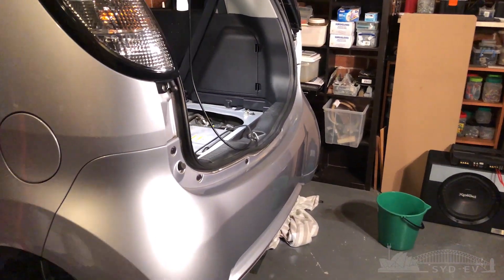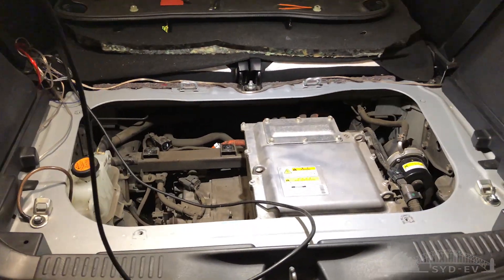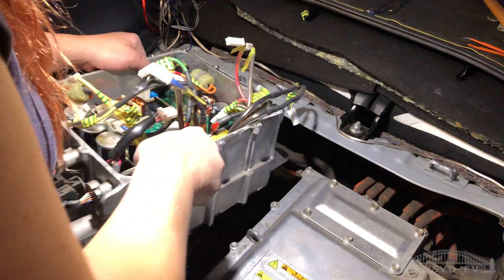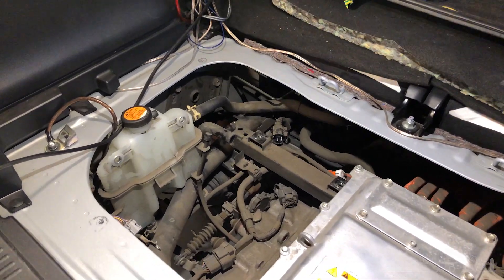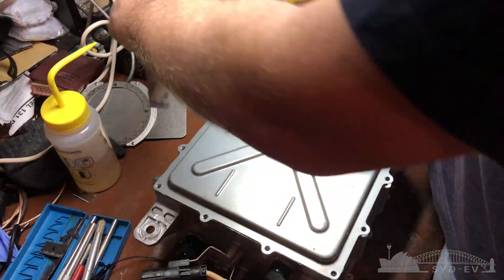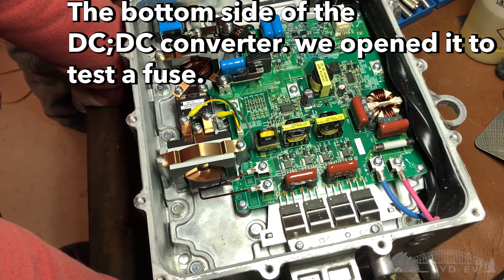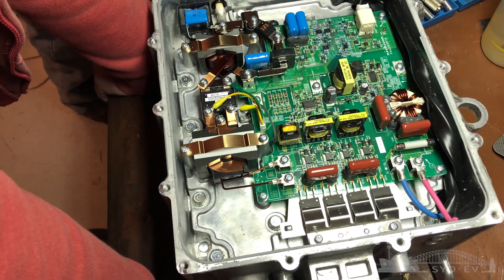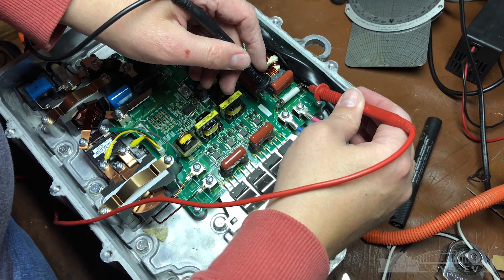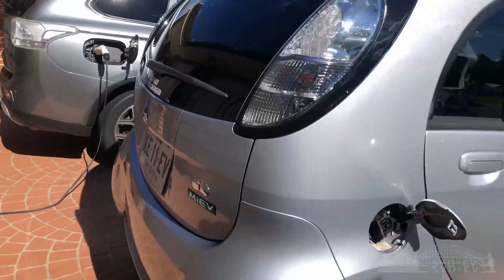That's pretty much the end of part one. The next video covers the actual repair of the converter itself. The repair was quite simple — basically soldering on two new capacitors that had been destroyed and replacing one fuse in the motor controller. Total cost of the repair was about twenty dollars: two capacitors from Jaycar and one fuse from Mitsubishi themselves. So it's actually not that hard to repair if this is the actual problem with your DC-DC converter. Thanks for watching and I hope you get your car fixed soon.